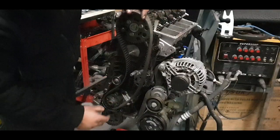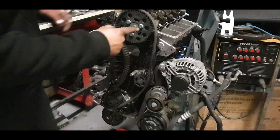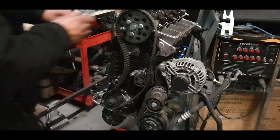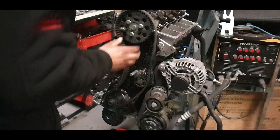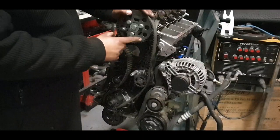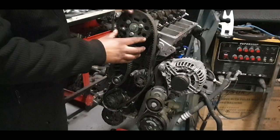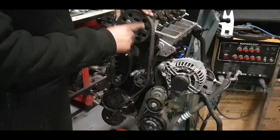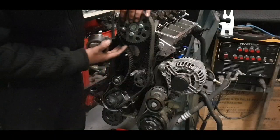I'll start to put the belt on the bottom on the crank pulley, and then I'll go to the water pump and work all the way. I forgot to release these bolts — I have to release these three bolts and make sure the pulley moves freely. If the pulley doesn't move freely and you try to adjust the tension, you can't set the torsion value. If it's seized, just take it off, clean it inside with sandpaper, and she'll get back to normal.